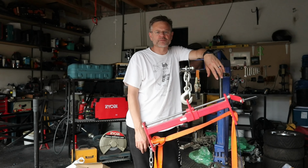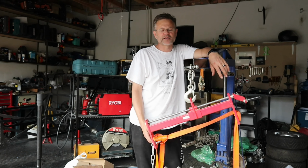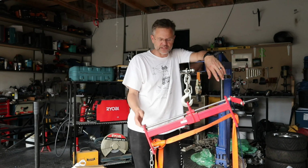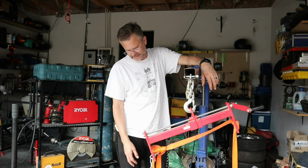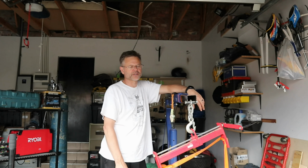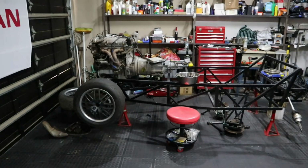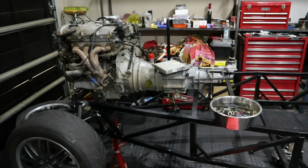And then also tomorrow we'll get the electronics for this motor, which means we will be able to wire up a make-believe oil pressure switch to just see that we get oil pressure. So we'll do that obviously with injectors and stuff disconnected, hence the importance of finding a starter, and obviously bolts to be able to bolt the gearbox back onto the motor with. And for that really to happen, we also need a new throw-out bearing for the clutch. So I think it's time to make a little list. Send Ben to the spare shops. Would appear. And this is basically how far we've gotten. I think this is probably going to be a wrap for today's video because it's getting a bit long already.